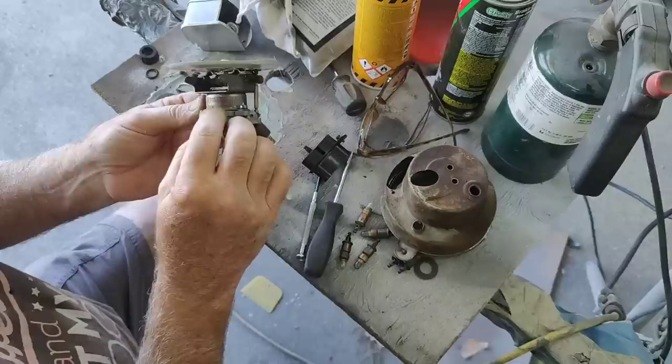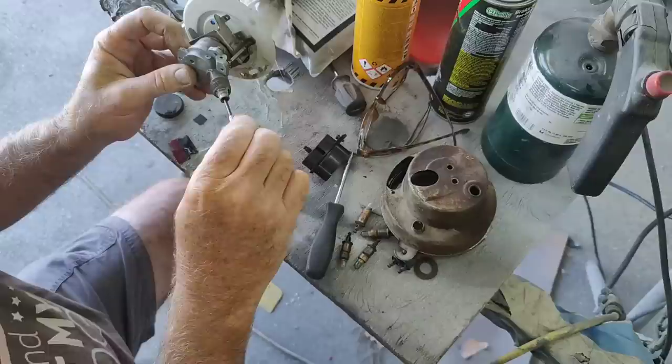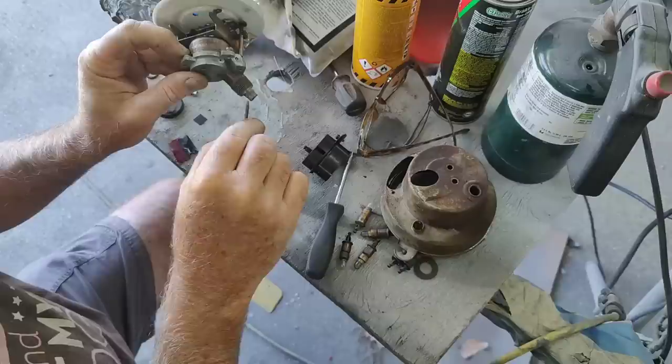Take those two off, and then I take this off, and then it's really hard. You got to get the needle to line up, but there's a little tiny hole here. So it's not that hard, but where the problem always is, where they seize up, is right here. Well, this one seized. Yeah, this one isn't going to work anyway. Where it seized up is right in here. The grease just comes off of that shaft, and that's always where the issue is.